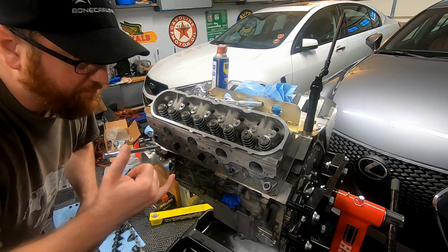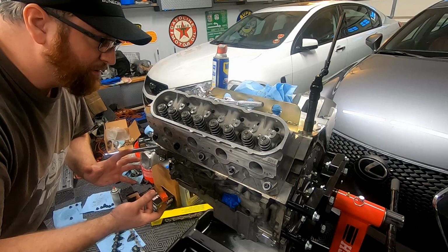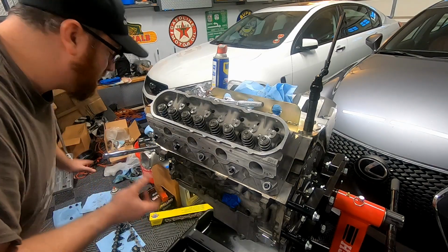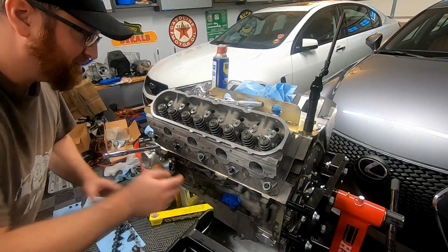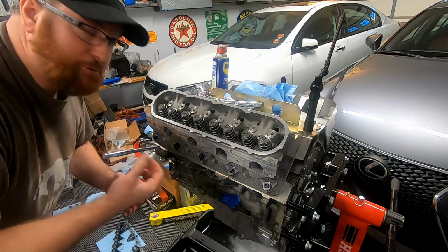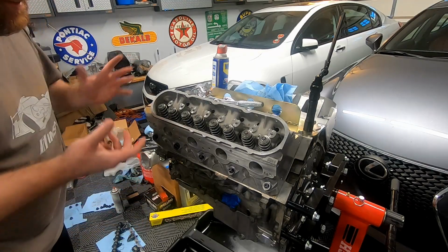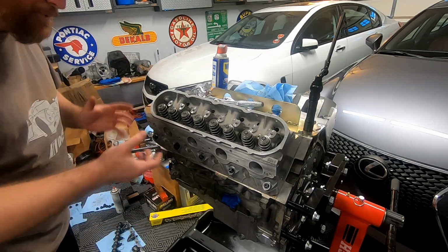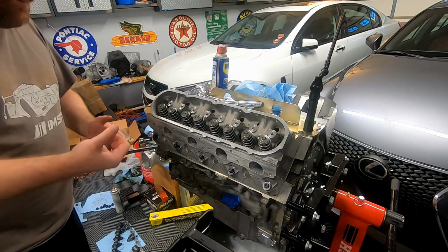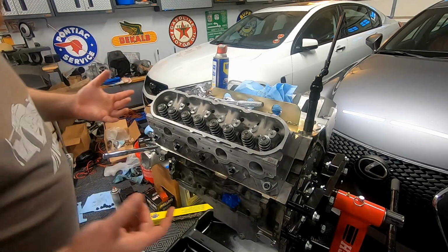We've got all the studs in, I've got all the washers in. Like I said, I just cleaned them off real good. Now we need to put the nuts on. It is a 9/16 hex socket, it's 12 point. I happen to have one of those. So basically the instructions for the nuts are put assembly lube, the Ultra Torque, on the bottom of the nut and on the threads as well. So you kind of want to overdo it. You don't need to be cheap here, put a lot on, because they really want that on the threads, on the bottom of the nut and the top of the washer. So go ahead, do that off camera because I'll be here for a while just getting super messy.